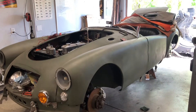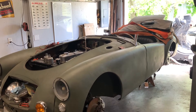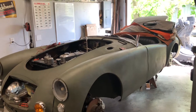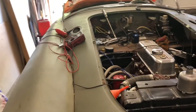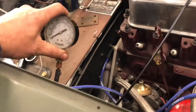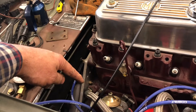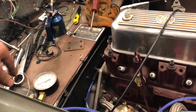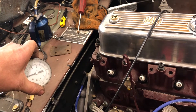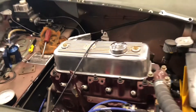MG Rob back with you, and today we're working on Captain Oblivious's MGA. We're going to try to get it running on its first start. We've already confirmed that we've got spark. I've got an external oil pressure gauge here, filled the block up with oil, and cranked it over until I got oil pressure without the plugs in place — showed about 60-65 pounds of oil pressure cranking, which looks really good. Put some gas in it and got ready to go.